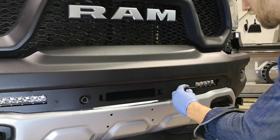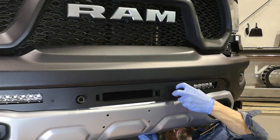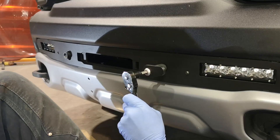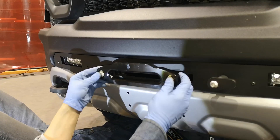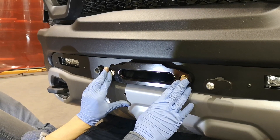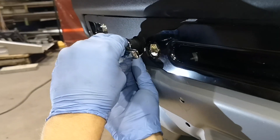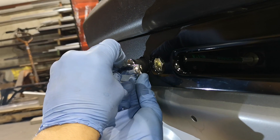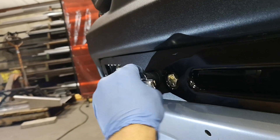Swing around to the front and install the retaining hook — note the powder-coated washer that goes between the mount and the fascia. Tighten with the supplied M12 hardware on the back. Now install the fairlead — an extra set of hands helps here. If you purchased the clutch relocation kit, reinstall the factory clutch handle into the mount on the front, noting the orientation: it should sit parallel with the ground when the clutch is engaged.